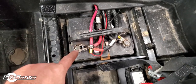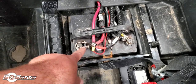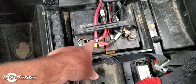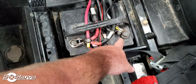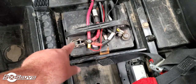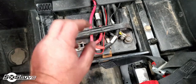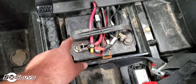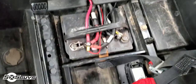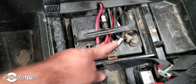This is the factory OEM Polaris lead-acid battery we're taking out. As you can see, we've had to do some trail fixes on the terminal — the factory one failed. We also have three direct tie-ins plus an accessory wire. Over time when you bundle them up too much, that creates too much stress, creates a fracture down the vertical surface of that connection, and it'll fail. We ended up going to O'Reilly's and picking up a replacement that had an accessory terminal already on it. For this trip we're going to replace the battery, and when we get back we'll put in bus bars, an isolator, and hopefully a second battery.